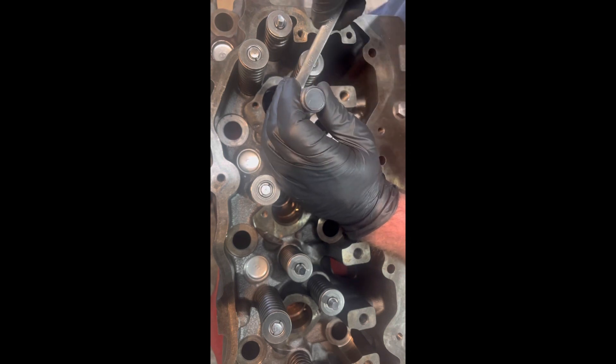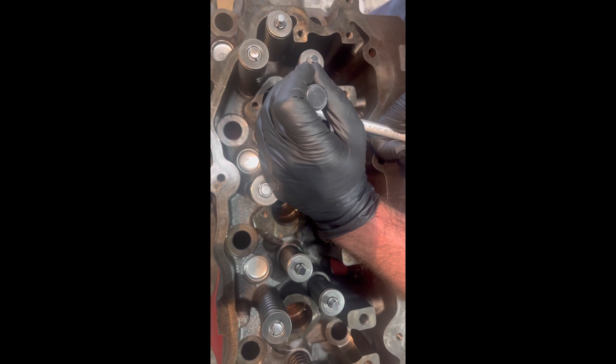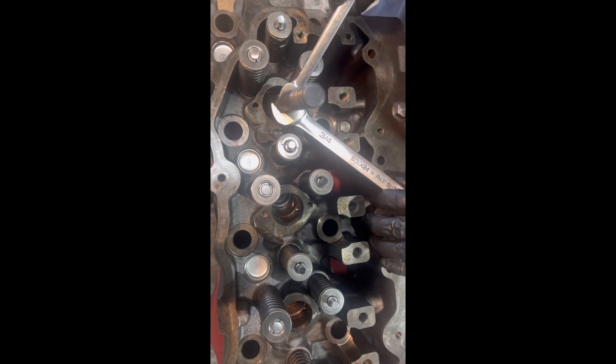Use a half-inch wrench. The four pins are starting to pierce into the cup now. We're going to put another wrench down here at the bottom — this is a three-quarter wrench — so we can get some better leverage. You've got to get these pretty tight before we can remove the cup. Slide this collar on there, then the center guide, rolling washer, and nut. And it's as simple as using our ratchet with an inch-and-eighth socket to pull the cup out of the head.